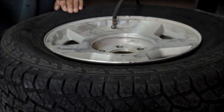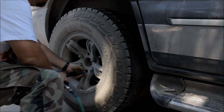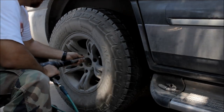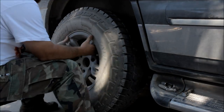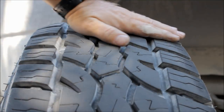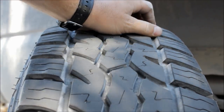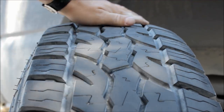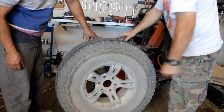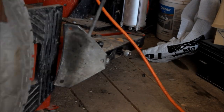Once we get these squared away, it's time to pull one of the tires off of my Tahoe. Now, it's been six months. We've put a ton of miles on these — hard miles on the dirt, a lot of pavement miles. As you can see, the tread is worn perfectly even. There's no high spots, no low spots, no funky wear. So from the outside, all indications look good. But just to be thorough, I wanted to pull the tire off, check the inside of the rim, and check the condition of the beads.